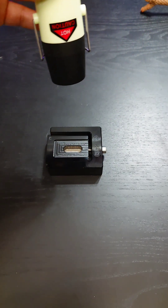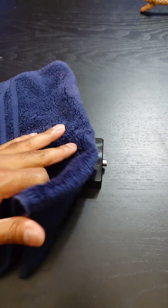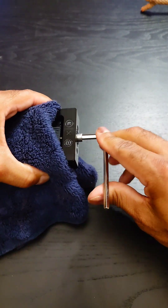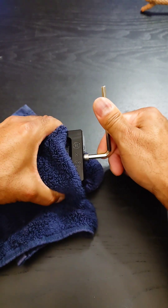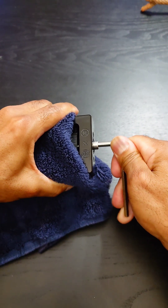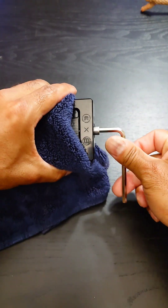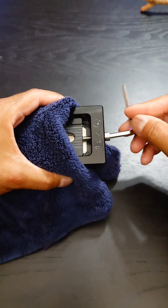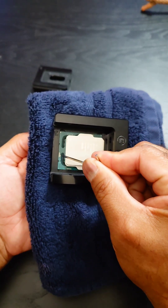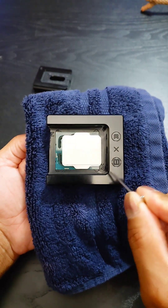This could be a good 10 minutes. We've been just over 140 degrees Fahrenheit for a little while, so we're going to make our first couple of turns here. This is something that you just want to be assertive on. Just had a little bit of give right there. This is definitely nice and hot. I'm going to let this cool down a little bit. You can actually see the black glue that I was speaking of and how the whole IHS is shifted forward this way, or to the right.